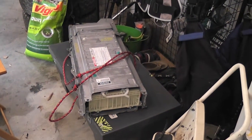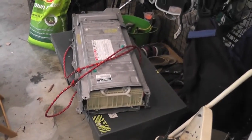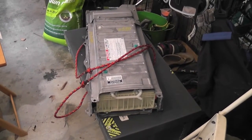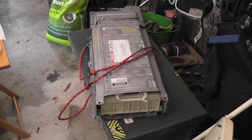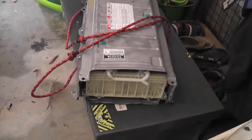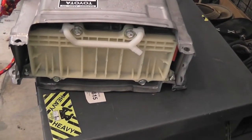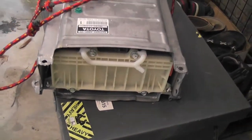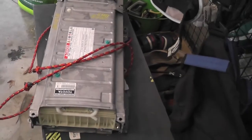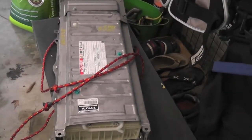This is the second Hybrid Battery Depot battery, sent in another reusable shipping container. It had two zip ties on it in shipping, but both zip ties were broken when it arrived via FedEx. The bottom vent was distorted, but I've bent it mostly back. I'm going to do a little more bending and test fit the ductwork on it. Overall, a lot of the tabs were bent, but it doesn't appear to be distorted and should be able to be mounted with a little stretching and bending.